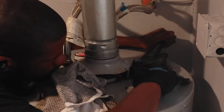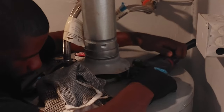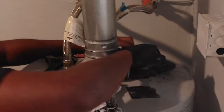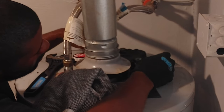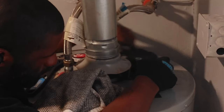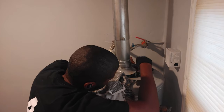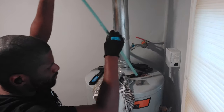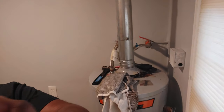I don't really know why this particular pipe wrench works so well with this water nipple, because there's nothing the teeth can really catch onto — the water nipple is completely smooth. But like I said, it works and it seems to be the only thing that will work, so you'll definitely need one of these. As I'm turning it, it gets easier to the point where I can turn it with my hand, and as I take it out you'll see there's a water line attached to the water nipple, so I have to take that off.